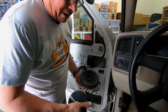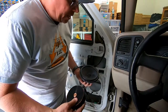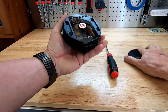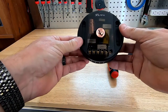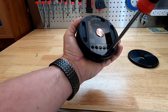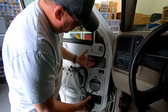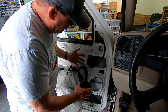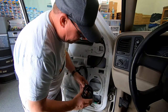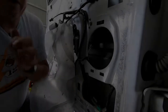Component systems are a little extra step to install because we've got to get the crossover in and wire it up. The first thing we're going to do is take the crossover — the top just pops off. You can see all the internals: all the wires go in through the little holes, you strip the wires back, put them in, and then screw down the little set screws to hold everything in place.